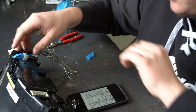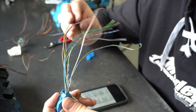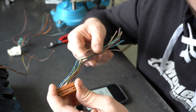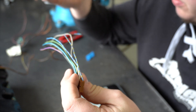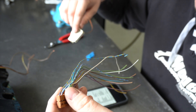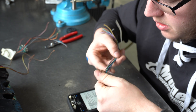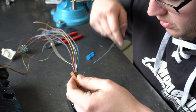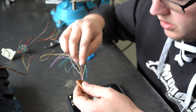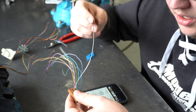Moving on to the X17 connector — that is this one here. I already thinned this out quite a bit for what I need. They're identical connectors, one's blue, one's white. If you look at the pinout it'll tell you what wire counts do what, and that's how I figured out which connector does which. Starting at pin one: one is unused, that's for hazard flasher relay, not using that. Two is the vehicle speed signal — I have the harness running up from the rear of the car for that, I will use this.